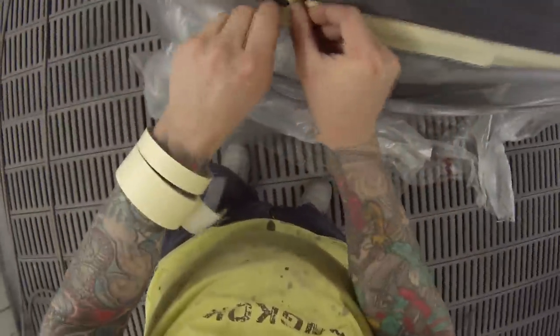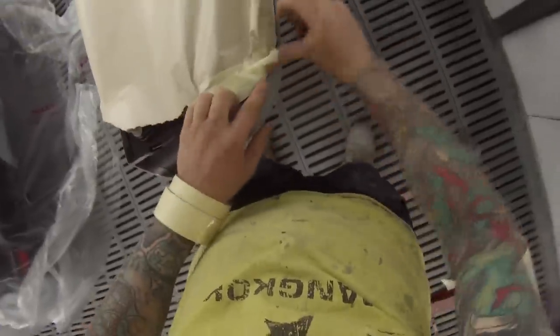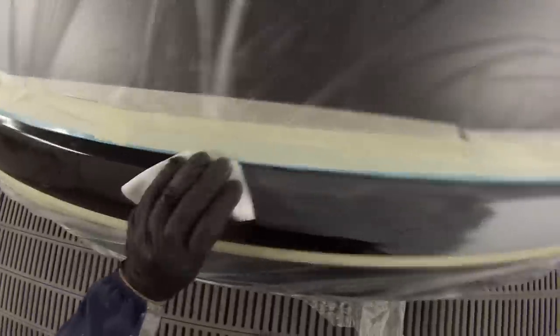There are some pretty good products on the market these days — we've got overspray clay bars. Talk to your paint supplier if you get a fine mist of overspray on the car you painted, because back in the day if we got overspray it was a big job to remove — we'd have to get the buffer out for cut and polish which takes hours. These days just a bit of soap on one of those clay bars and it comes straight off. You've also got little hand-washing pads that bring all the grime and overspray straight off when you wash the car.